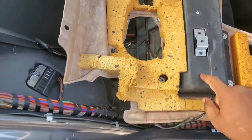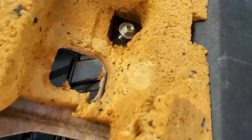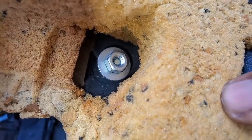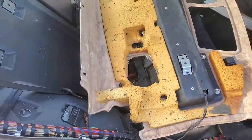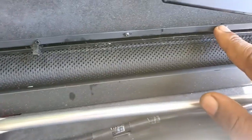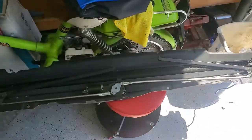One thing I've learned doing this: there are five bolts in the rear and five in the front. The ones on the rear you can just loosen — this piece is slotted on the back side, so you can just loosen those back ones without taking them out. The front ones you need to take out and it'll just slide right out. Also, a correction: the little screws that hold the cover in place are actually six millimeters, not 10. They're number-six Torx, so you're probably going to need a micro kit to get those out — most regular Torx kits only go down to about eight or ten.